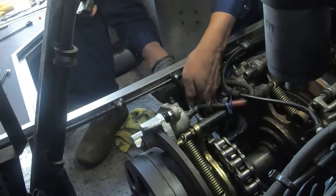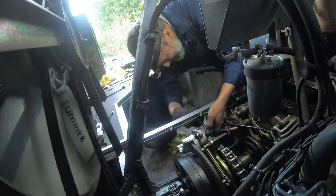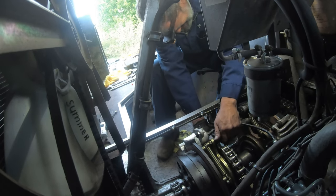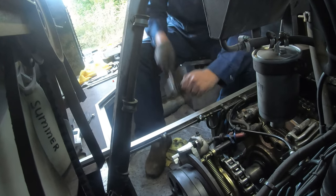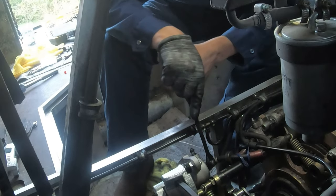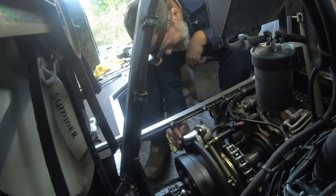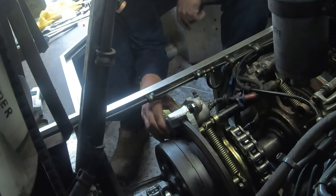Here's a picture with the hose properly installed — what I should have done at the very beginning. I'm not exactly sure what the torque specs should be, but I gave it a pretty good tightening. After I got the brake caliper installed, I gave one final snug to the brake line. Then we get those brake pads put in place, put the top bracket over the top of those brakes, and we're pretty much raring to go in terms of installation.